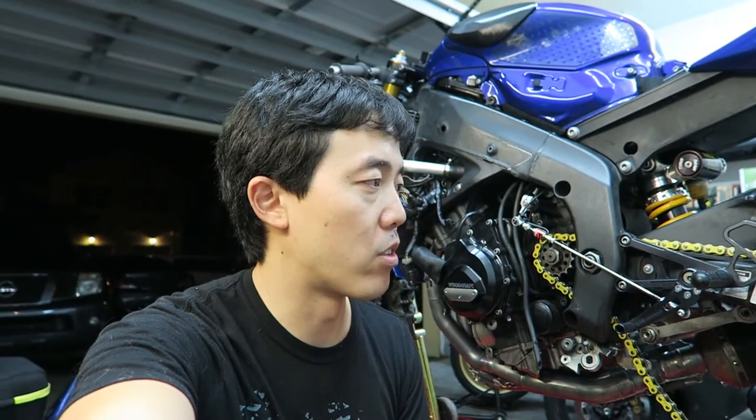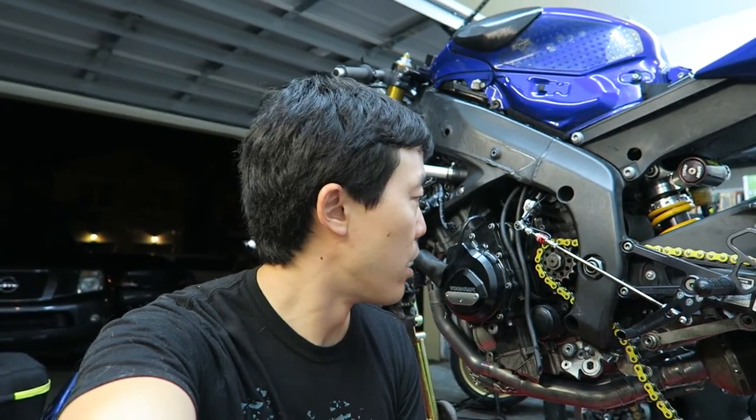Not only to do better, but also to protect your engine. If it's bouncing off the rev limiter a long way down the straight because you geared it too short, you could really hurt your engine. Daytona is actually known to blow engines quite a bit just because of the amount of stress you're putting on it going pretty much top speed for extended periods of time. So let's go ahead and change some sprockets out. We'll start with the rear sprocket since it's easier to do, then move to the front.